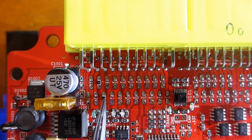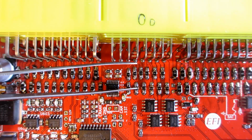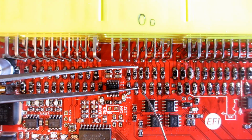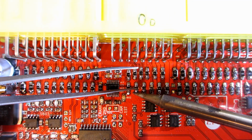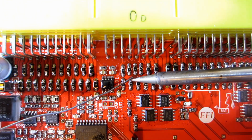If you are doing straight links, this should all be done in the stencil and oven stage, but I had used my standard technique of hold the part down, apply flux from the tip of some solder, preload a blob of solder on the tip of the soldering iron and just solder the joint. Then just solder the far side in the usual way.